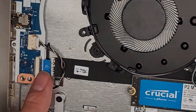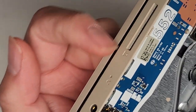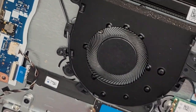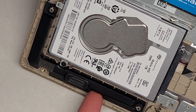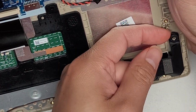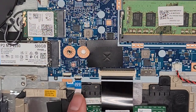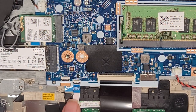There's a connector for the IO board — input/output board — that connects to the motherboard underneath the wireless card and SSD. That's for the SD card slot, one key recovery button, and the 3.5mm headphone/microphone jack. It also connects the speakers — the speaker cable goes down here and is held in with rubber, with little plastic tabs to hold it in place. The keyboard connector is here with a latch on this side, and the trackpad cable connector is here — flip the latch up. There's also some adhesive holding the cable in place.